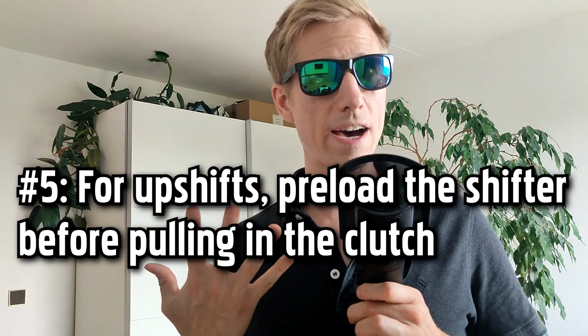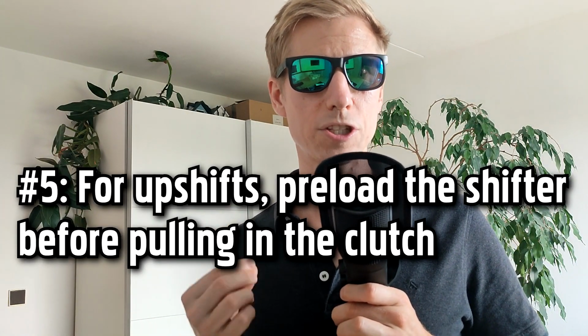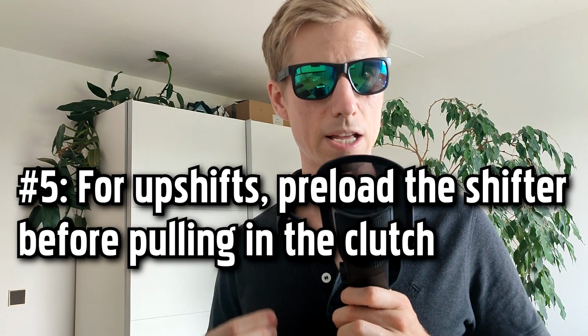Such a sudden release of clutch often results in hard shifting of the gears, and sometimes even halting the motorcycle. So, practice slow release of the clutch lever once you change the gears. The gradual clutch release will result in smooth gear engagement in the gear drive, in turn resulting in smooth gear changing in your motorcycle.